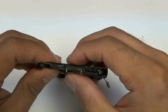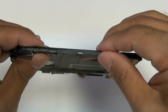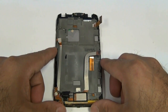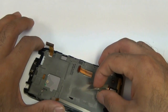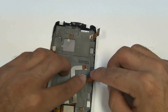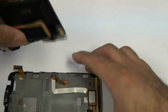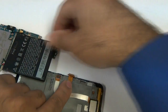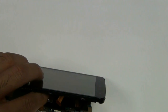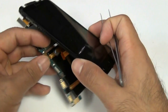Make sure it has a good tight fit. At this point, go ahead and fold your LCD flex cable as shown right here to the right side. This is a common issue people make — they don't plug it in properly. It does need to be folded to the right as shown. This is probably the hardest part of the phone — trying to plug that LCD cable back into the board. It doesn't really give you that much room.